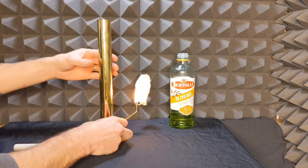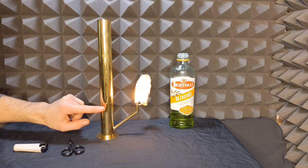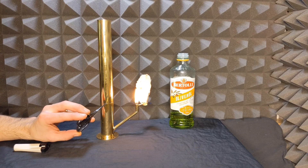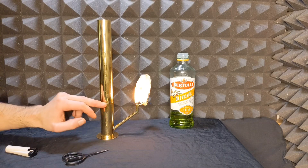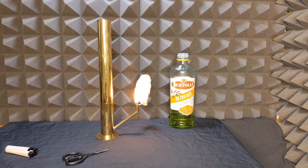One other problem: if you're not getting good burning, make sure that this little hole here is open. This is the vent hole and it allows oil to fill into the chamber. If that's maybe clogged or has something in it, that could also be a reason that it won't work.